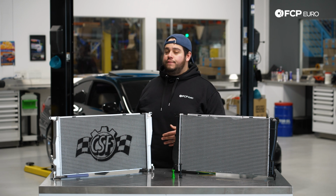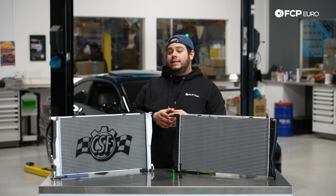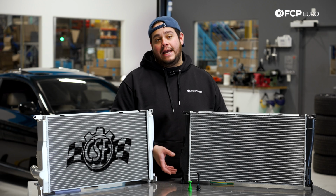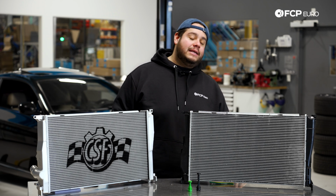As these vehicles age over time, that O-ring can go flat and just kind of shape itself to the neck on the old radiator. Oftentimes, if you still have the OE style one, the necks can actually break and then you have a neck stuck in your hose. So if you can, I always recommend that as well.